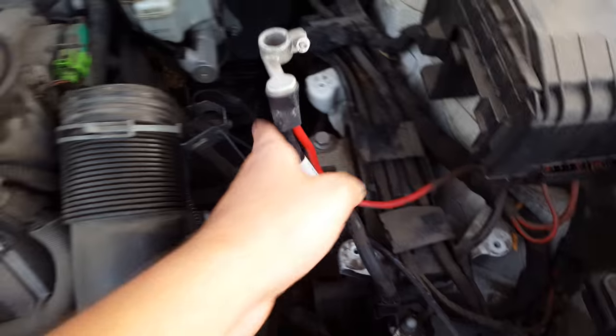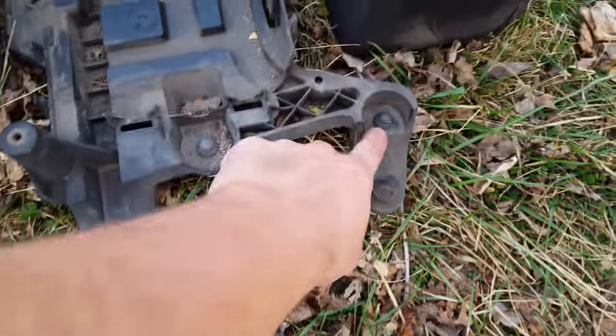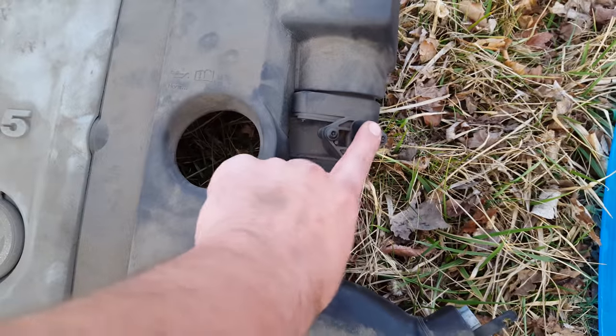The first thing I did was pop out the battery — a couple of 9mm bolts popped that out. Then the battery casing that goes in here, that was one, two, three bolts. Then I took this cover off right here — all it is is two bolts here and here and a hose clamp here. And then I pulled the sensors out.